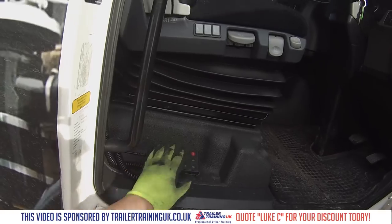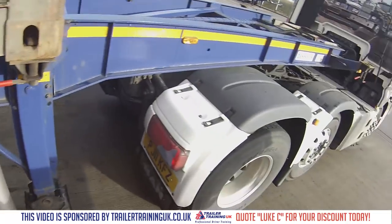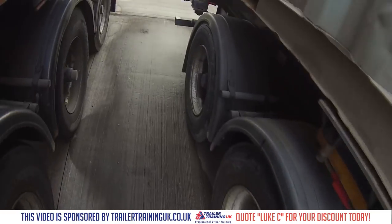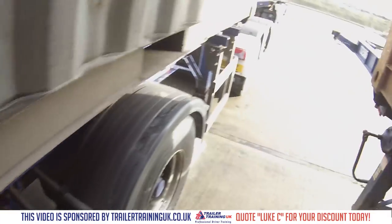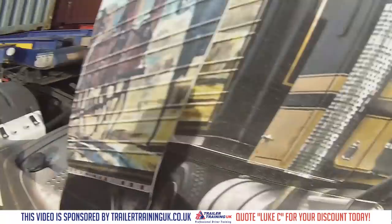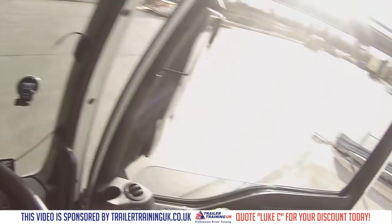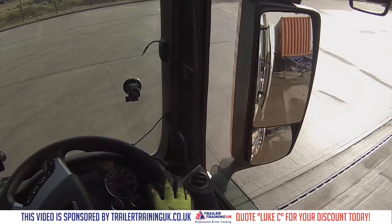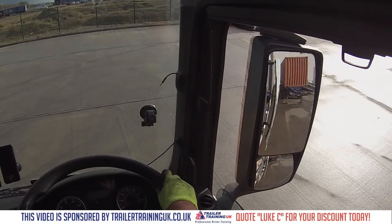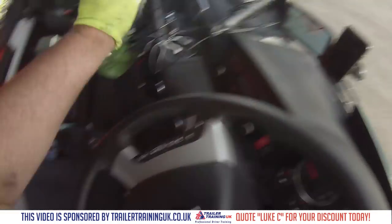So what we're doing now is we've got to make this go forward — basically we're lengthening the trailer. Okay, that's all the way up. Now we're just leveling off the suspension. Double check there's no lever to pull on this one. Doesn't appear to be a lever, so hopefully we should just rock it forward. Remember the trailer brake is still on so the back wheels won't move. Go back, go forward — there we go, we released it. Now we're all the way forward.